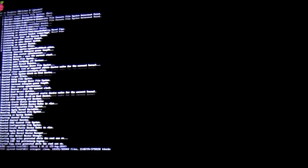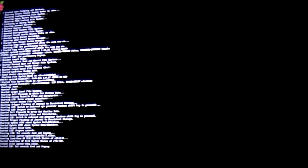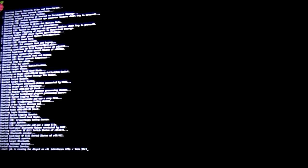On booting up the system, you're going to see a bunch of letters on the side of the screen, and then that screen will flash. You're going to see a bunch of OKs to the left side followed by a bunch of different words. If you ever see anything that says 'fail' in red, then you might be having an issue on the motherboard or with the chips. This here is just my custom logo — it's just telling you about my company and my website. It takes about 30 seconds or so, and then you'll get to the next screen.